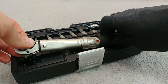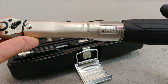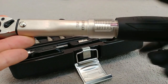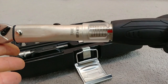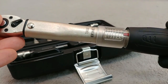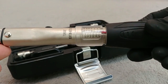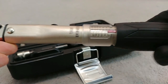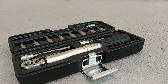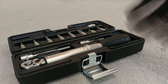The last thing to remember when using the torque wrench: when you set a certain torque and use it — let's say four newton meters — after using it you should reset the torque wrench to the zero position. This way it will always work fine and give you the click at the right torque. Never leave it set; always reset the torque wrench and it will be ready for another use. If you have further questions or suggestions, put those in the comments — thanks for watching!